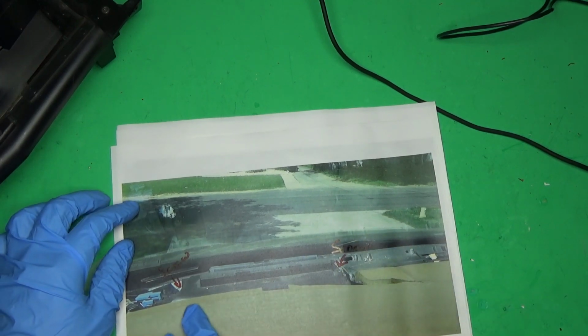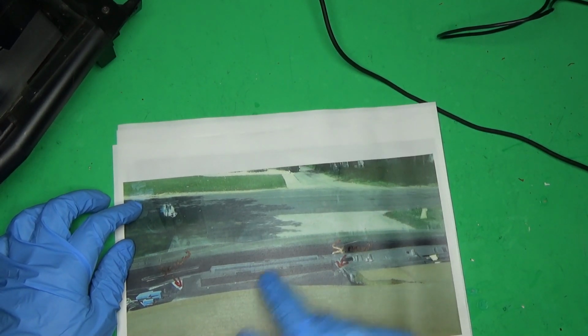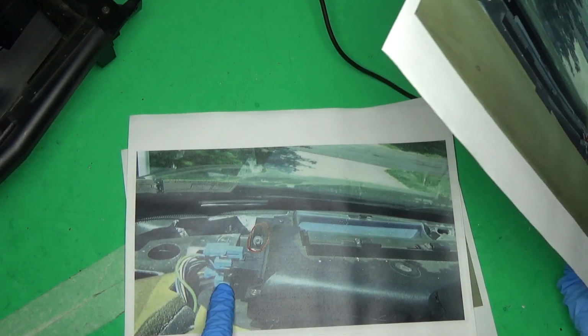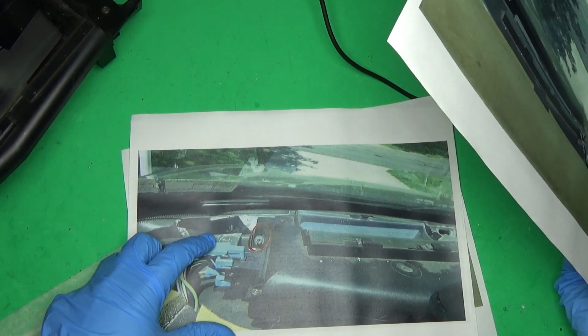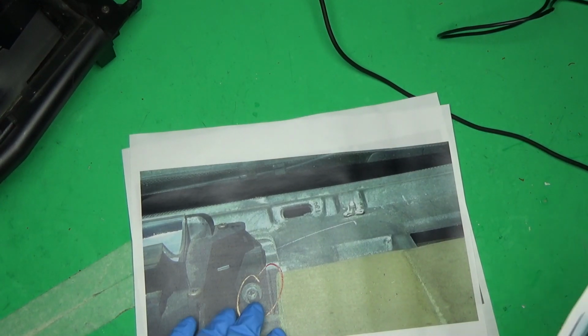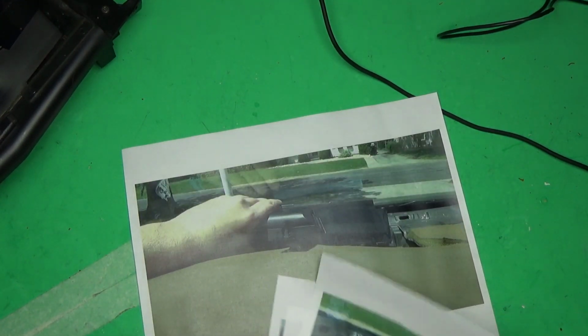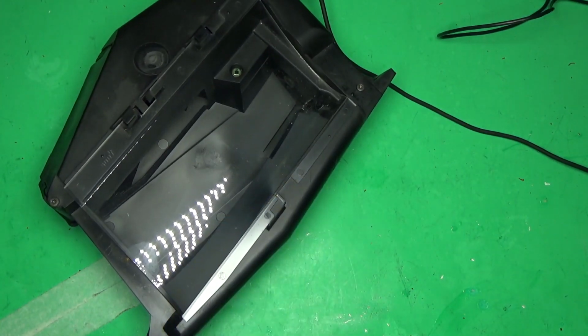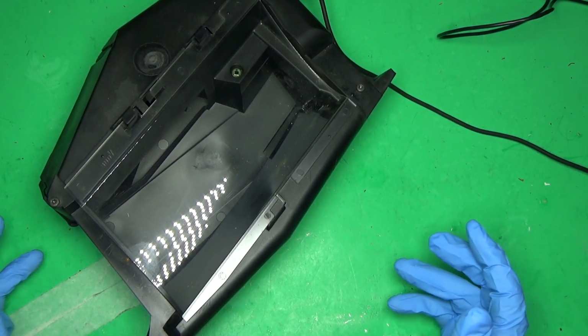But once you get it off, you see there's the heads-up display unit. There's a screw on the right and the left, and they look like this. There's also a connector you have to disconnect. You just push down on there and it pulls off. And on the right-hand side, there's one as well. And just those two screws, you can reach in and pull it out. So, there it is. It's not too bad.